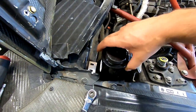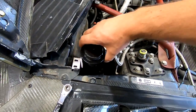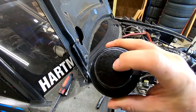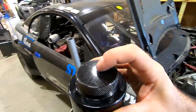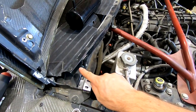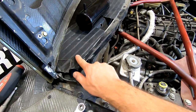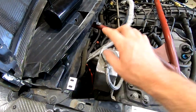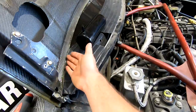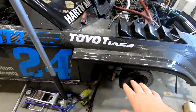This is going to get strapped to that down low enough, because what we're going to do, this little pressure relief hole right here, we're going to open that up and actually tap it with an NPT tap and put a barb on it. That barb, we're going to hook a little hose to and poke through this cowl panel or something somewhere. That way, if this ever gets so hot and pushes so much water into the reservoir, it'll come out and hit the windshield right about here, rather than pushing out anywhere under the car.